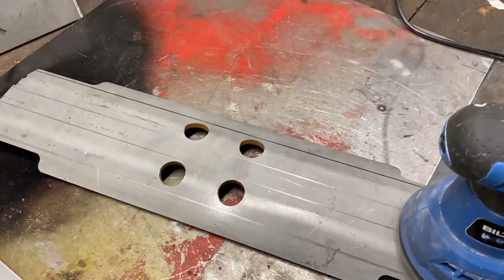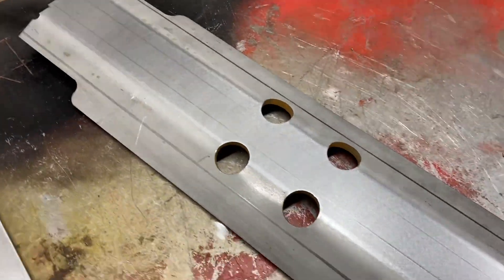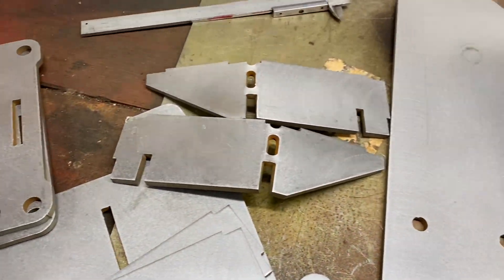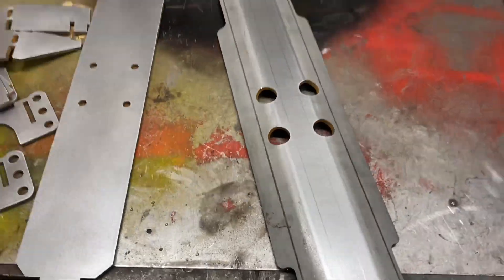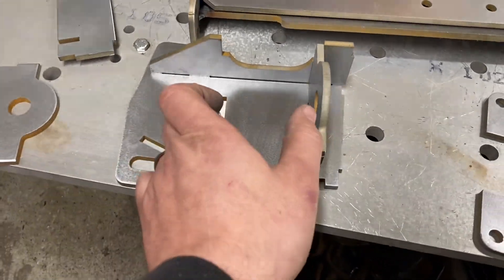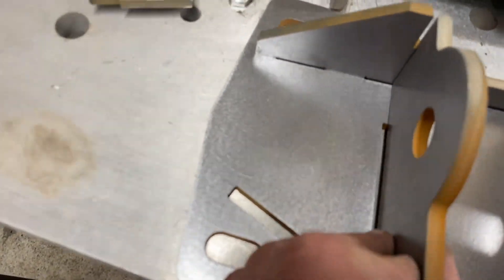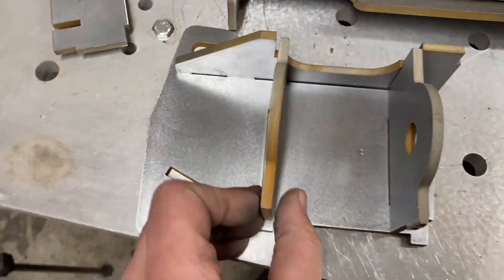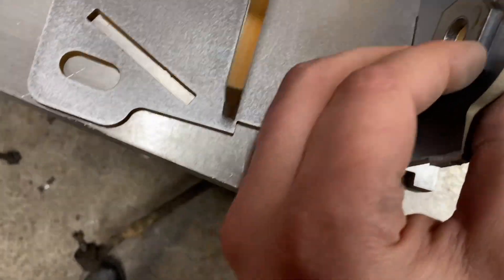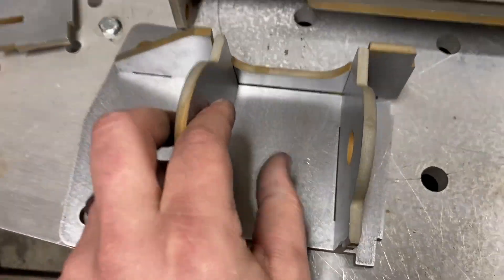Now I have the puzzle back home and start to prepare them for the assemble and weld. In my control arms I'm gonna use a bit smaller bolts and a bit narrower bushings, so I need to move this bracket a little bit from this groove down there, about somewhere around there. And then I need to weld on here for the smaller diameter bolts — one there and one here on the outside. And that will give me the perfect distance in between for my bushings.